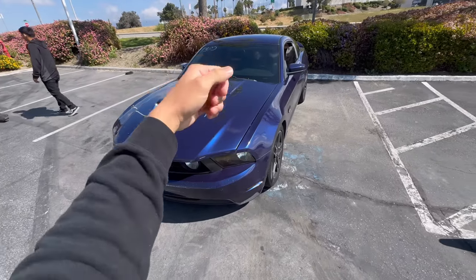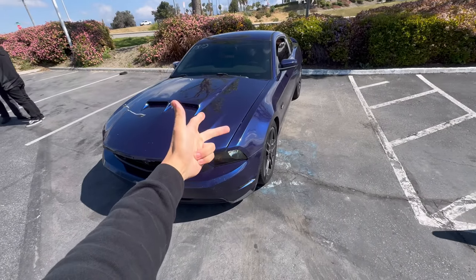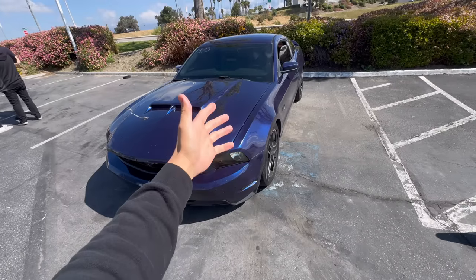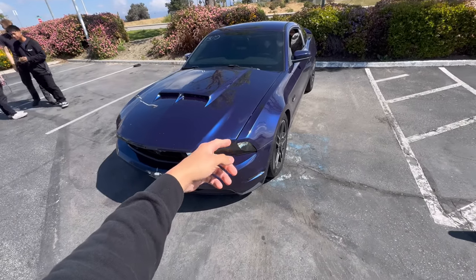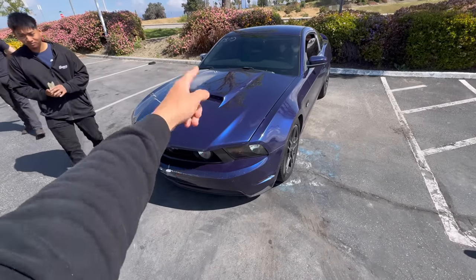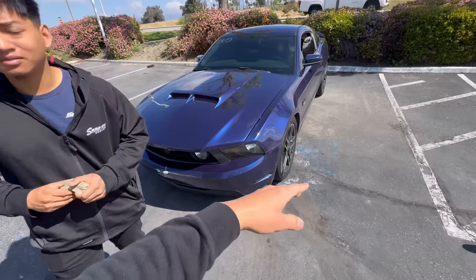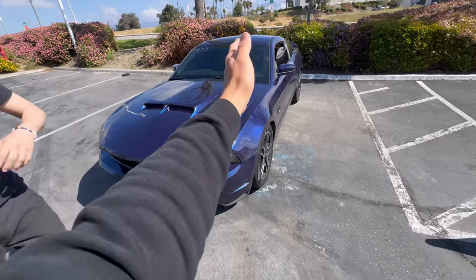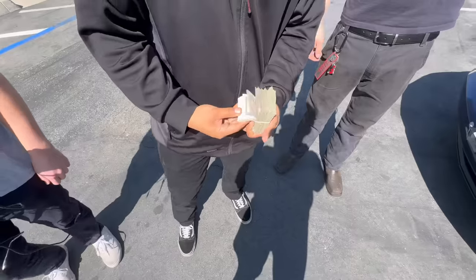For this car, I'm doing a Gen 3 block, forged rods and pistons, forged crank, doing my Gen 2 built ported heads with oversized titanium valves and heavier weight springs and retainers. I'm doing custom cams. We're also gonna rev to 10,000 RPM, doing a Holley Hi-Ram, long tube headers, and then we are going to do a 150 shot of nitrous. So I have my NA setup and I have the nitrous setup. That's what we're doing with this car.